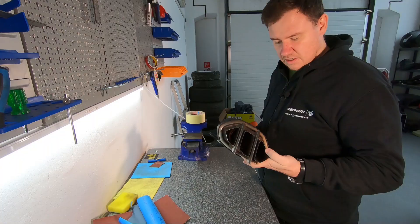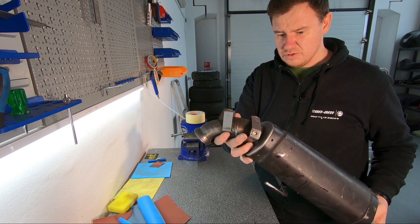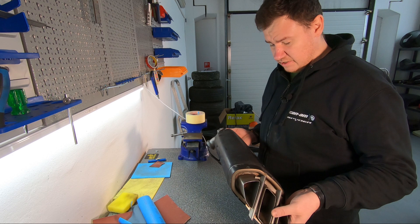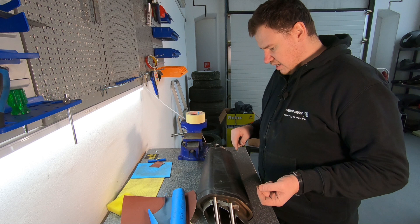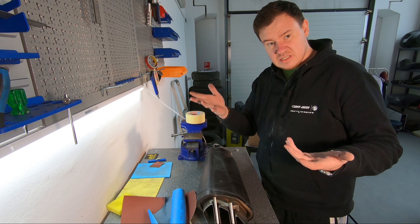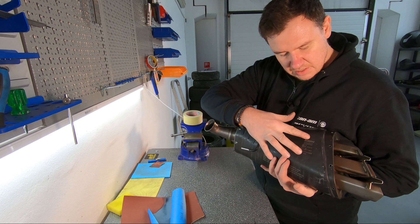The exhaust is as clean as possible. Of course I put some extra work on this part that I probably didn't have to, but once the exhaust is off the bike and you're doing a restoration after many years, why not give it some extra work? What I will do now is wet sand it with 1000 and 2000 grit sandpaper to remove scratches and bumps, so when we apply the black matte color coating there will be no visible bumps. And of course we'll duct tape the areas I don't want covered in black matte — like the serial number, the Akrapovic badge, and this text right here.